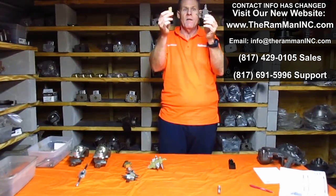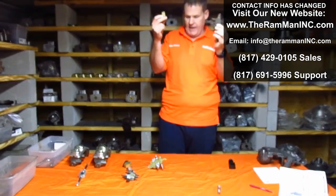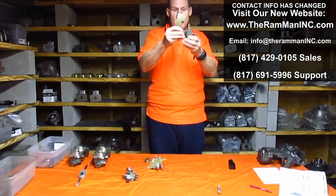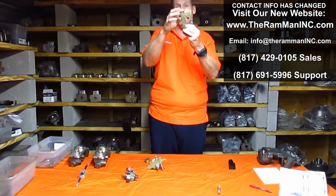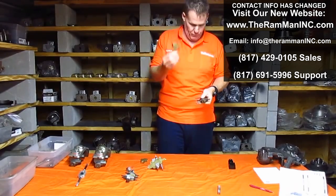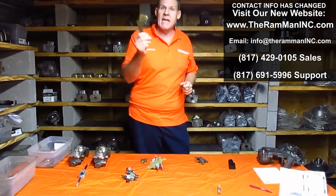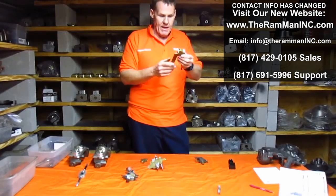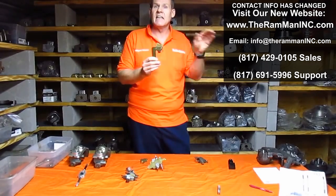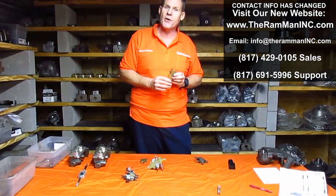You've got these two blocks. Then come along about mid-1969 through about January of 1970, Mopar said, you know what we're going to do? We're going to add a metering valve to the front brakes. This was a big improvement. The front metering valve — this is the beginning of ABS brakes. This valve right here doesn't allow anything to go through it until it reaches about 130 PSI.